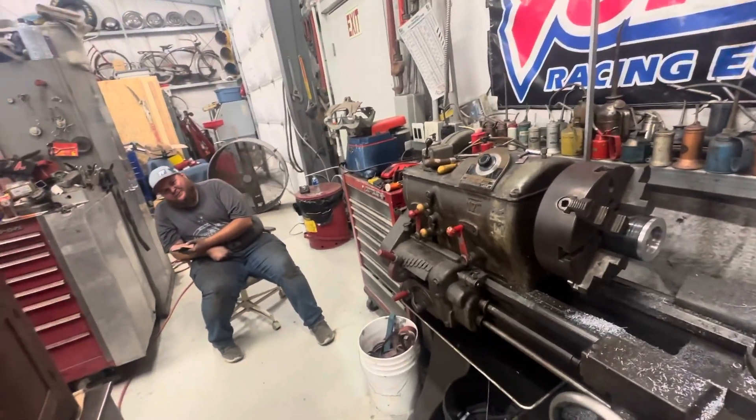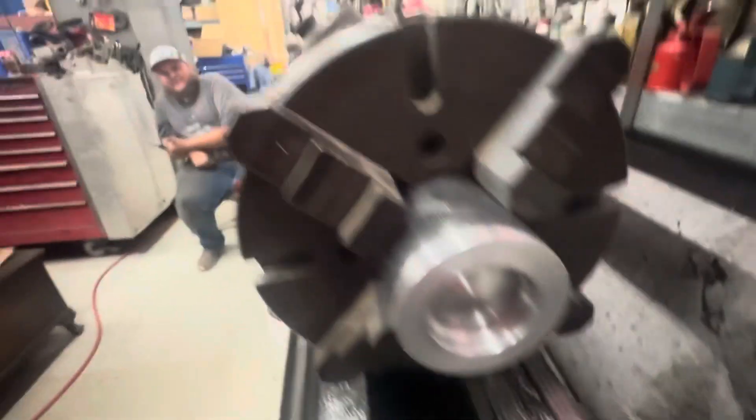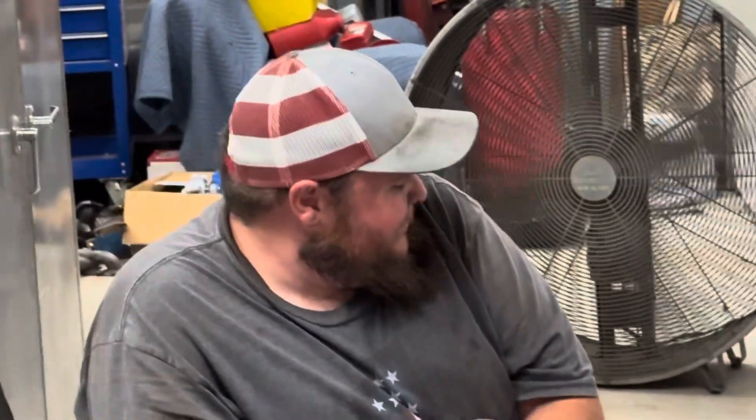That's the last Jake McNasty piston we're making today. How do you feel about them? I think they're going to do great — I don't see any way it could go wrong. So the secret is: it's 50 thousandths off the top of the piston for the alternate fire cam, because pockets would be way too easy. And then D-lip it — 180 thousandths D-lip. It's perfect. Once Robert polishes them up, they're going to look pretty and they're going to perform great.